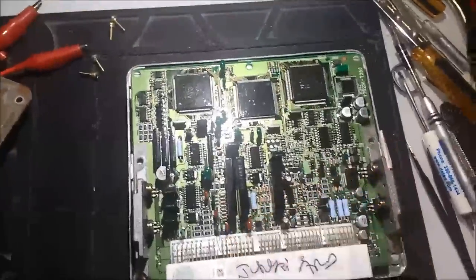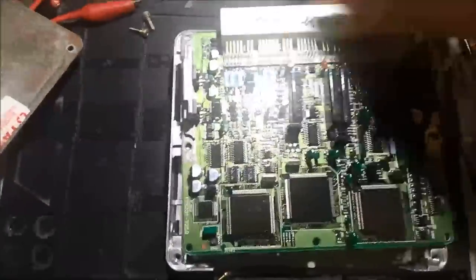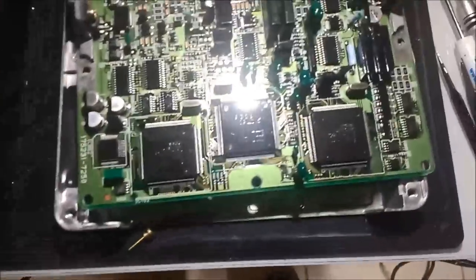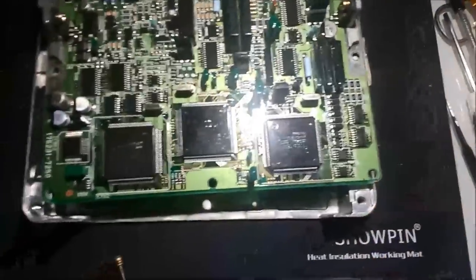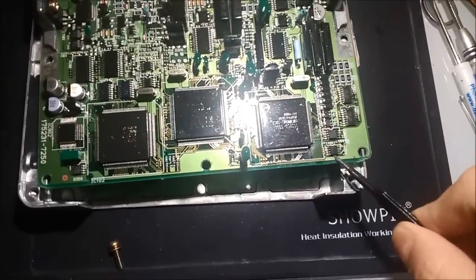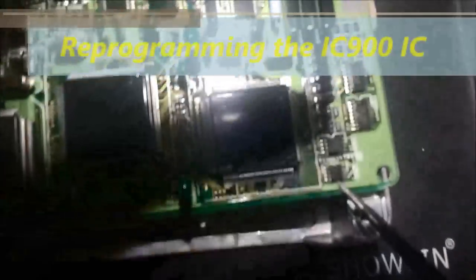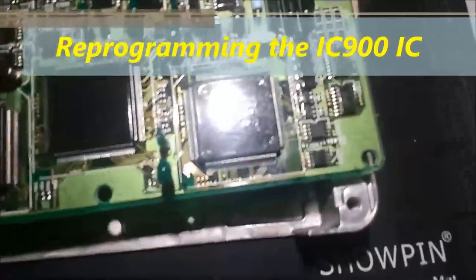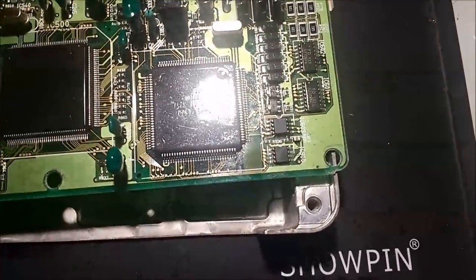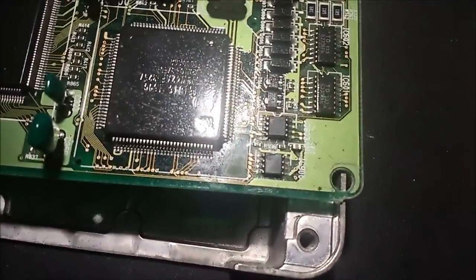The procedure involves either replacing the IC or reprogramming it. The IC itself costs about $0.50 or even less. You also have to buy an IC programmer, which is probably around $19-$20 — no big deal. The circuit we want to remove or reprogram on the PC board is the IC900. That's the chip designation used for probably 15 years inside the ECM itself or the immobilizer computer.